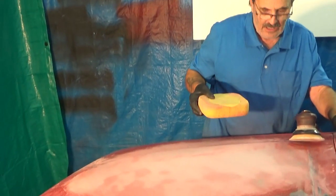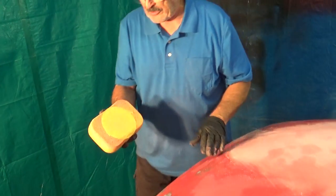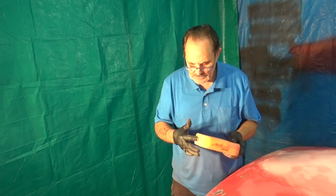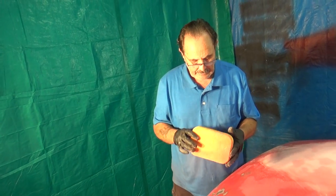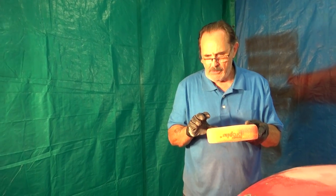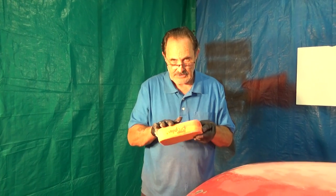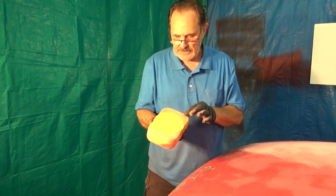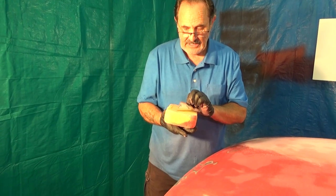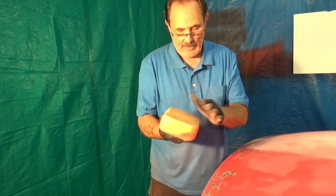Now let's move to the front of the truck just a little bit. I'm going to show you a little device that I use — it's nothing but a sponge that tile people use for doing the grout. Basically what you've got here is this little piece and I've got a piece of adhesive-backed 320 on it — this is obviously meant for the DA sander, it's ramped. But look, this thing will fit the contour. It fits the contour. Look at that.